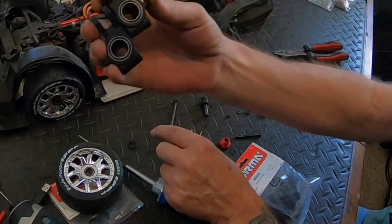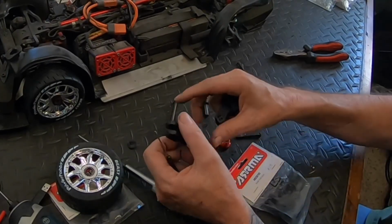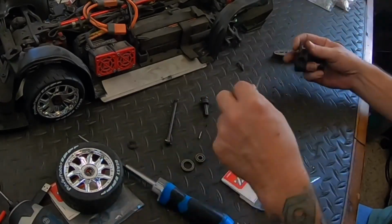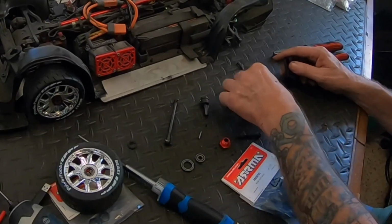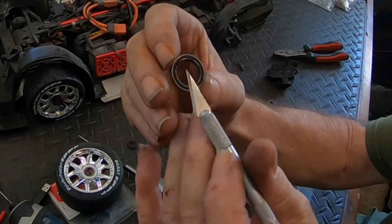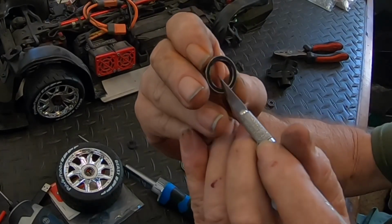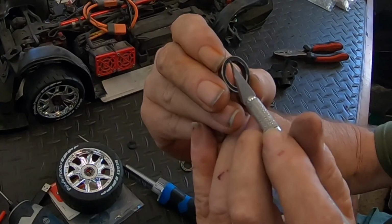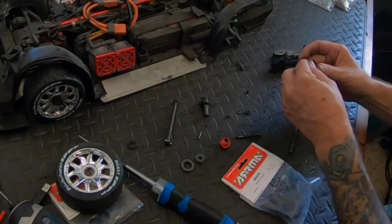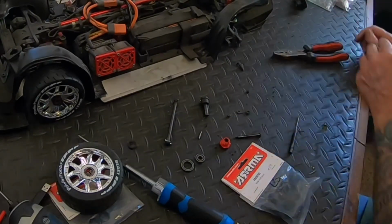So these bearing carriers that I have are for an EXB Kraton, and that's why they don't fit. I thought most of the Arrma stuff was the same, but it's not. As you see, even on this inner, I'll show you, you can see plastic got up into this. So plastic, dirt, you can tell that the plastic got hot. Now the bearing itself is fine, but I'll keep them, I'll re-oil them, and then we'll get them back in there.